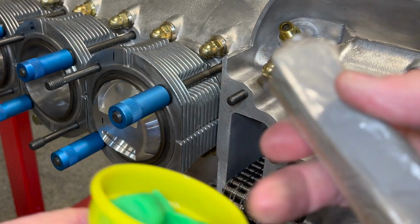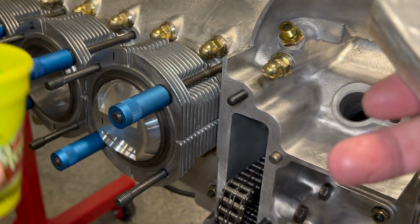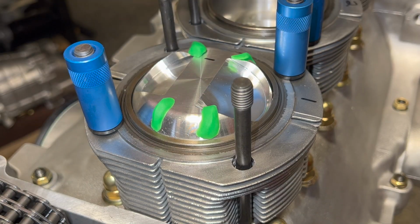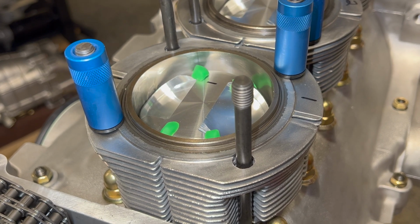It'll be easy to put on and take off, and it'll give us a real nice impression. So we're going to go with this to do our testing. You could use both, but it's going to be a lot easier on this one to run Play-Doh through all 6 cylinders and get an impression than modeling clay. Okay, and then making sure we're not going to drag it down the cylinder sides as we're rolling through, like we're going to be clear.